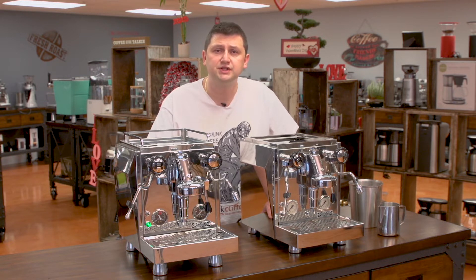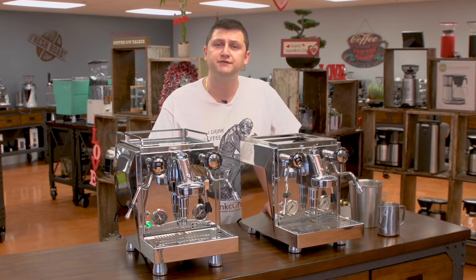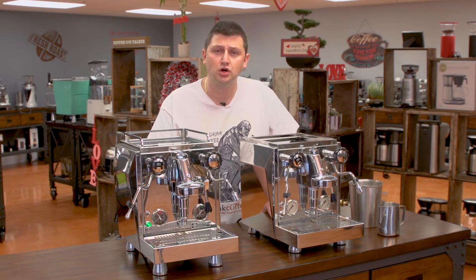There are a number of reasons why you may want to drain your boiler. For example, if you want to transport the machine or send it somewhere, it's important that there's no water inside the boiler, especially in the winter, because it could freeze. Freezing does serious damage to your machine. Another reason is if you're going to store your machine for a longer period of time — it's important to drain your boiler to prevent any scale buildup.